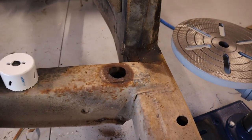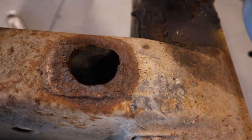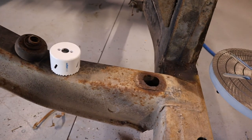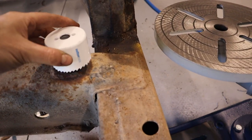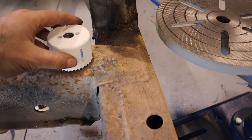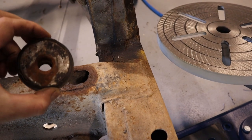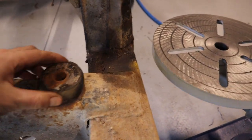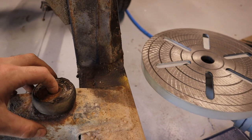Okay, so just going to repair the cab mounts on the rear — they're both pretty shot on both sides here. Pretty rusted, so I've got a bit of an idea of how I'm going to do it. I think I'll just use a hole saw to cut out the rusted bits. Should be able to pick up the centre using the old mount, but there's a lip here so that still semi lines up, so if I can use this for the centre.